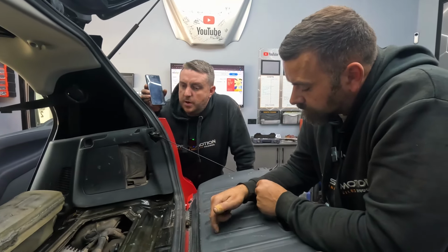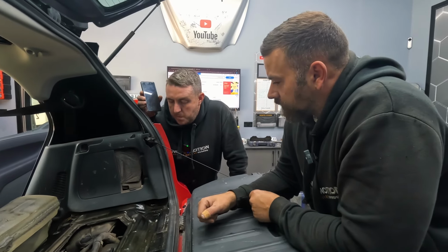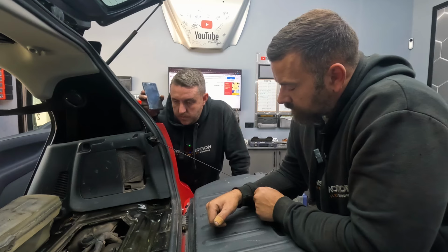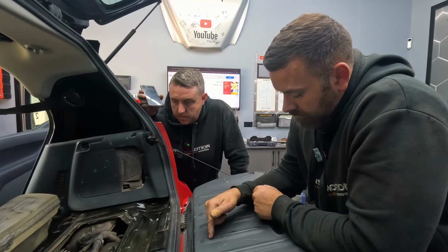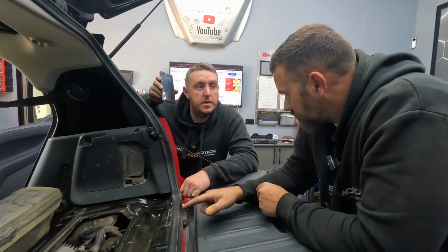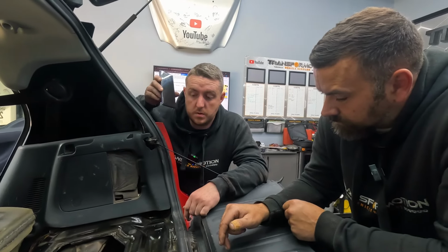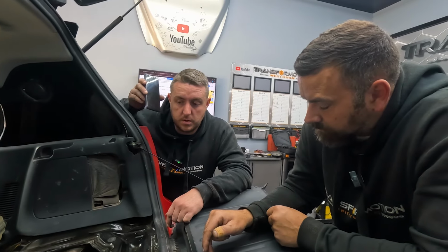But if you had big ends gone, would it not bang like mad all the way through the revs? You'd have thought so, but sometimes when you get to a certain peak they just tend to go quiet, unless they're really bad. Would there be loads of metal in the oil if we dropped it? That's a good point. You would have some metallic filings in the oil, but I'd try that.